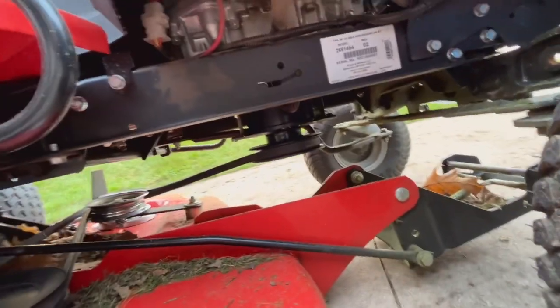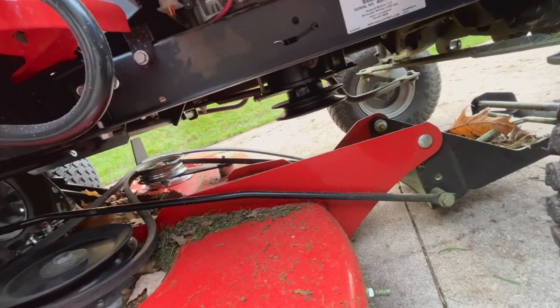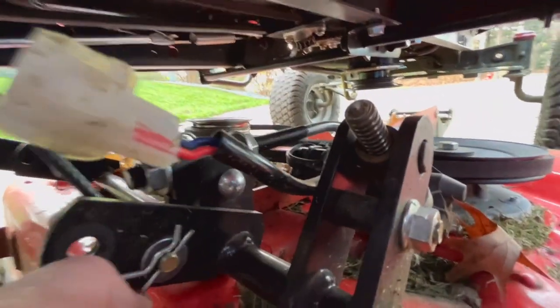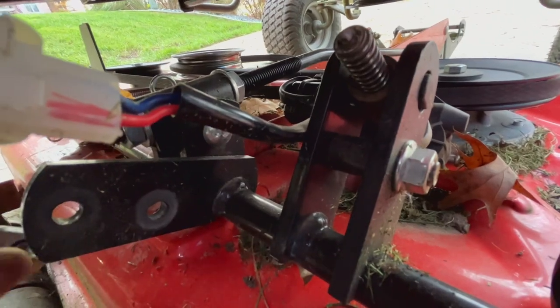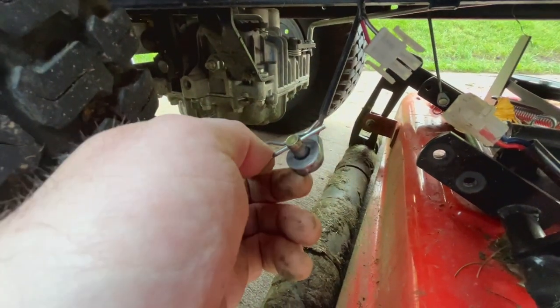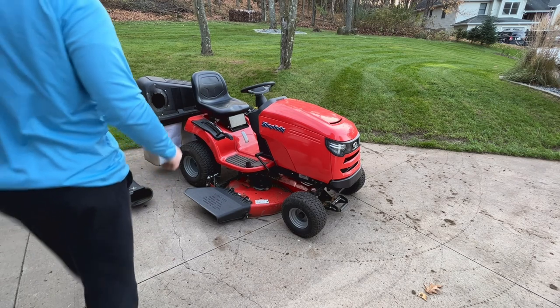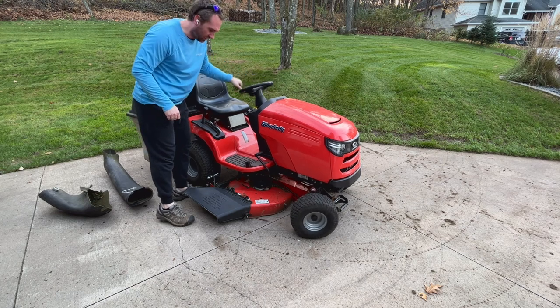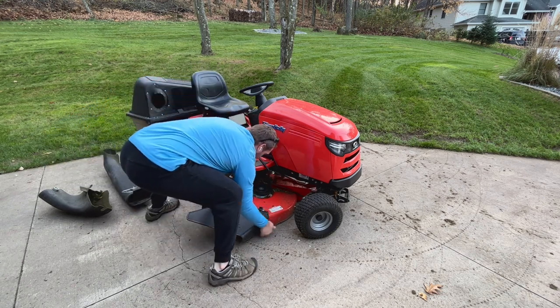Once it's down, we can see our drive belt there and easily disconnect that. The next thing is to disconnect our lift cables — those are the pieces in back. Just pull out this cotter pin and make sure we don't lose our washer. I like to put that washer and cotter pin back on the lift cable so we don't lose it. Once we have everything disconnected, we can put that lever back up top and get it out of the way. Then I like to turn the wheel all the way to the left.